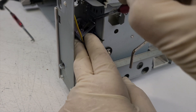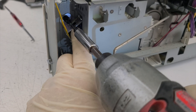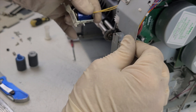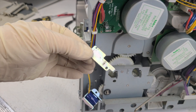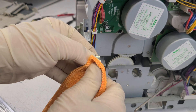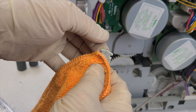If you experience printing issues from tray number two, one possible problem is the solenoid responsible for that tray. Test the other solenoid in the exact same way and check for any sticking issues. The upper solenoid handles printing from tray number one. Signs of a malfunctioning solenoid include jamming or the tray picking up multiple sheets of paper simultaneously.